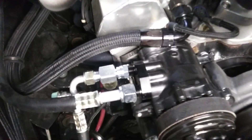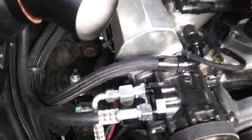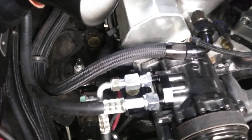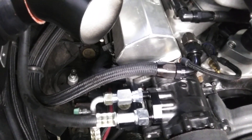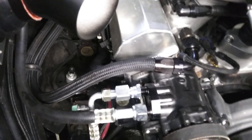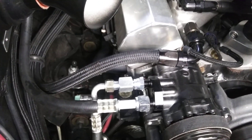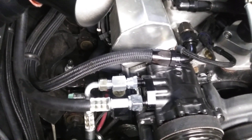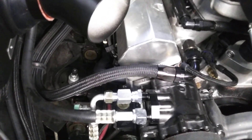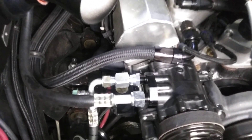One of the biggest differences between R12 and R134 is the oil used in the refrigerant. R12 was pretty much low pressure — like 20 to 40 pounds and R12 would do its job. Not the greatest job, but it did its job. R134 needs between 40 and 180 PSI — somewhere in there, 40 to 50 on the low pressure side and 160 to 200 will work on the high pressure side. That's my experience.